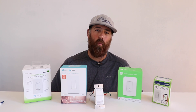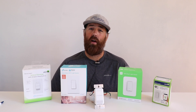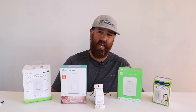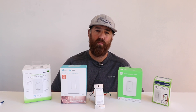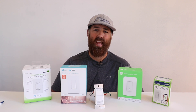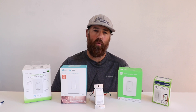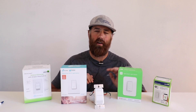The number one issue is that most Wi-Fi switches will not connect to 5 gigahertz routers. Now most 5 gigahertz routers have both a 5 gigahertz and 2.4 gigahertz band. So when you're setting up your Wi-Fi switch, you need to make sure that you connect to your 2.4 gigahertz network, or temporarily disable that 5 gigahertz network while you are trying to connect your Wi-Fi switch.